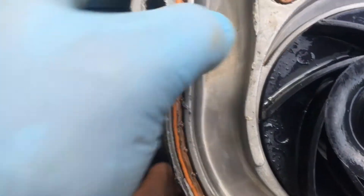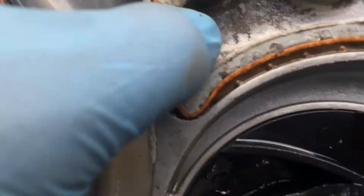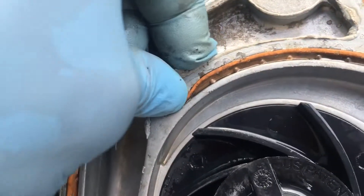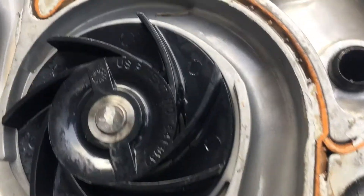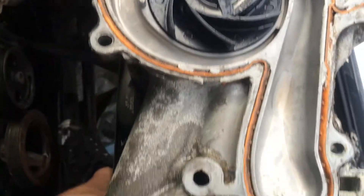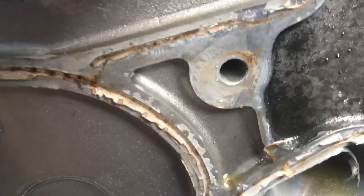It hasn't made it go faulty, but it didn't work either. This stuff was leaking like a sieve. This is what gets built up — all that Alumaseal, liquid aluminum, Bars Leaks. I tried a bunch of different things before taking on this water pump. Look at that — this stuff's just going right in the motor. All that debris. That stuff never really works, and the proof is in the pudding.